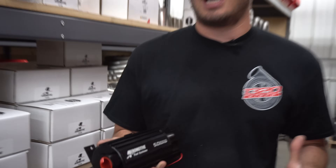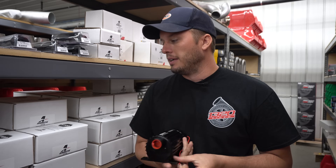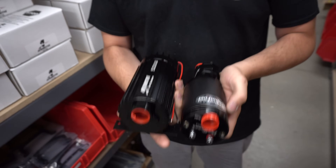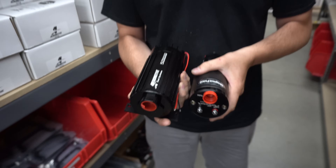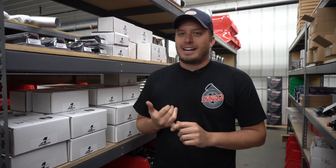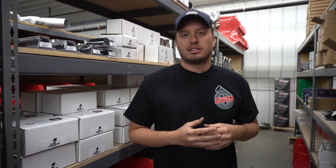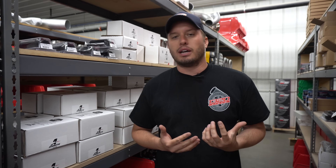When people tap that pump out — and it's not hard to make a thousand on E85 these days — they'll upgrade to something like this Aeromotive brushless pump, a five-gallon-a-minute brushless pump that will make almost sixteen hundred to the tire on E85 in a boosted application. They're almost the exact same dimensional size on the outside, which makes the swap really nice and easy — basically unbolt one, maybe a small bracket change, a couple adapter fittings, and you're back in action. The problem is that gives you a false sense that's all you need to upgrade your fuel system.